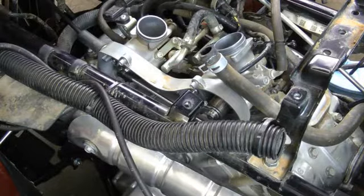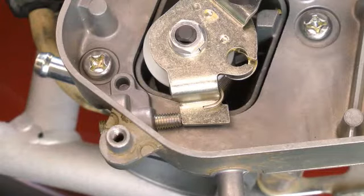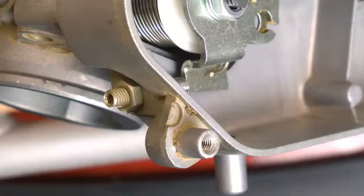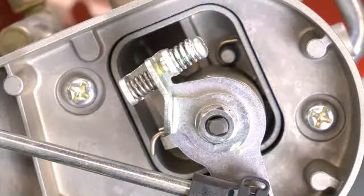Once that's done, take a close look at the physical throttle stop on the throttle body assembly. There should be firm contact with no clearance between the stop and the throttle bell crank. This is so that the throttle plates at rest are cracked open and not touching the inside of the throttle body housing. Resist the temptation to tinker with this adjustment — it is closely matched to other settings and could result in considerable time wasted. Likewise, avoid adjusting the mechanical throttle sync, as it is rarely, if ever, actually necessary.